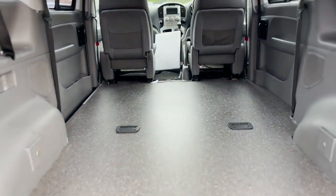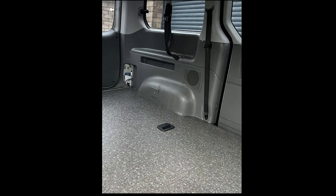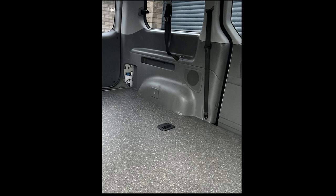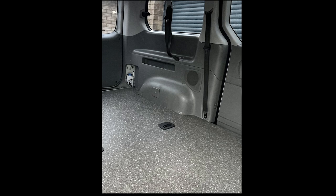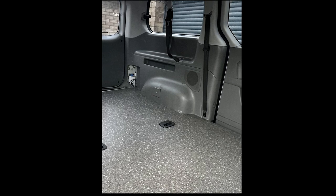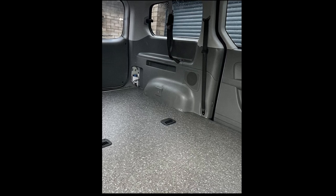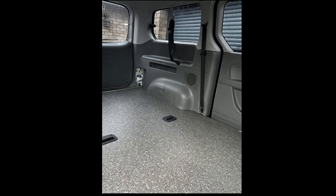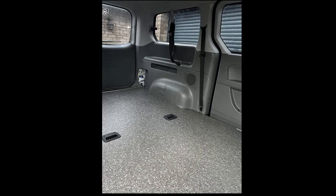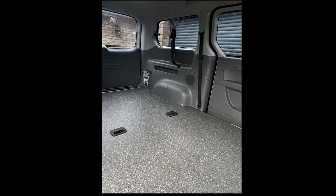Next on the list is a rock and roll bed being fitted. In the i800 I've had to have this custom made for a lower ceiling — the top of the seats covers should be 35cm above the floor, which matches the old seats we took out. This is some 10cm lower than the standard rock and roll beds made for VW transporters, which appear to be higher especially with the pop tops. I don't plan on adding a pop top to this camper van conversion.